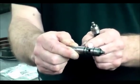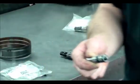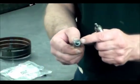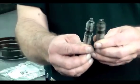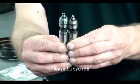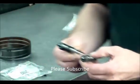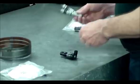The second feature of the pin is it has two Teflon rings that go on it, because this case can tend to wear and the rings help prevent oil leaking from the case wear. You can see it is 200 thousandths longer, which cuts that band travel in half.